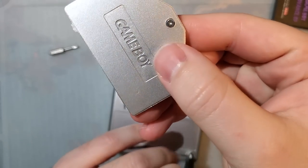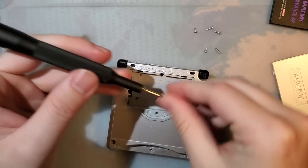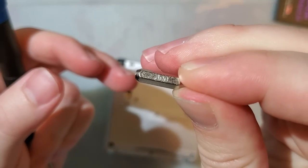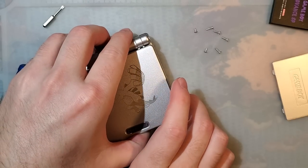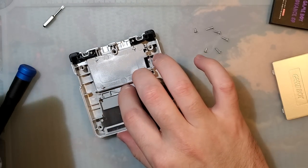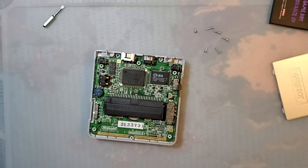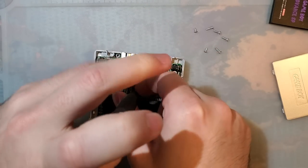The battery cover comes off with a small JIS screwdriver. In my particular case, I'm using the J00. JIS is not Phillips. They look very similar. In a lot of cases, you can use one driver in place of the other, but not all cases. Your life will go so much smoother if you use a JIS driver instead of trying to make a Phillips work.